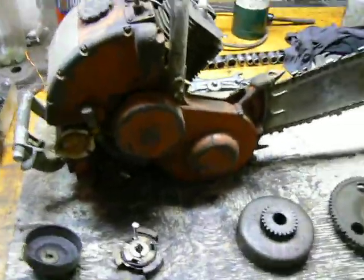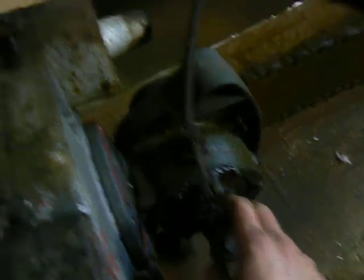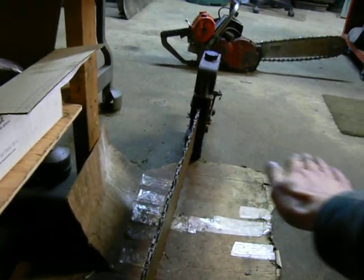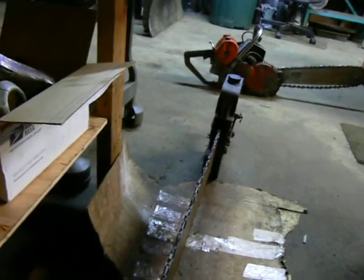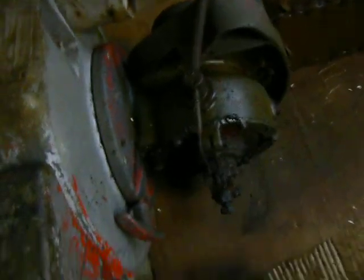So that covers it. One last drive method. It's going to be a little dark because I can't really drag this thing around one-handed. We have my Lombard GS two-man chainsaw, and this has a manual clutch — as opposed to centrifugal — here's the clutch lever. I don't know exactly how it works; I haven't taken it apart. But in order to fell a tree, the bar has to be rotated flat to cut a wedge in a tree, and then rotated up and down to cut a tree into sections. So this head can rotate.